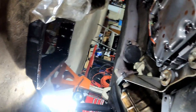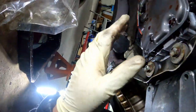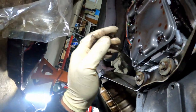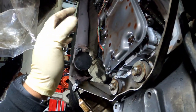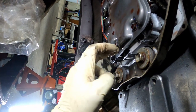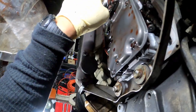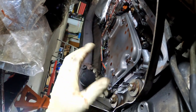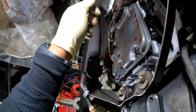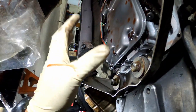That was heavy. I'm going to take the pan up and clean it out and slide this up under here because stuff is still dripping. This is the filter — you got three bolts here, 10 millimeter — one, two, three. Take those out. While you're under here, check all these other bolts — your valve body bolts — they're all 10 millimeters. Just make sure they're still tight because over time they can get loose. Don't over-tighten them. If they're loose, snug them up and make sure they're tight before you put everything back.